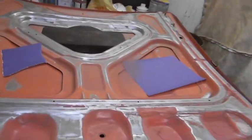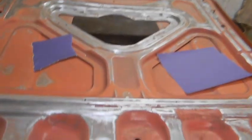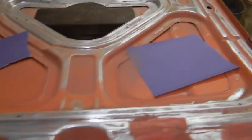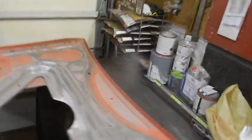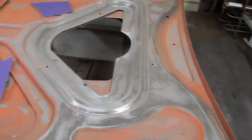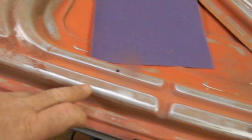I don't want to take any chances. Anything outside where this series of holes is, is getting sanded to a point. All the major flats are going down, this crevice here is going down. I did that complete area, now it needs to be final. This is pretty much at 150, I'm gonna bring it down to 220, but this is all sanded in here because this is crap laying in here. From here out I'm not gonna strip in here — that's gonna be impossible — but we are gonna make sure that it is smooth.